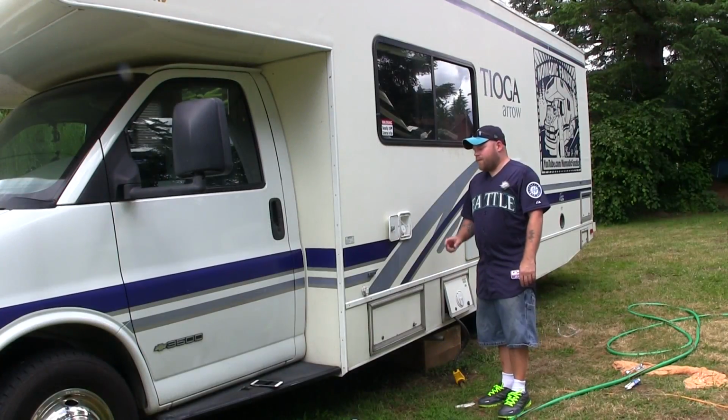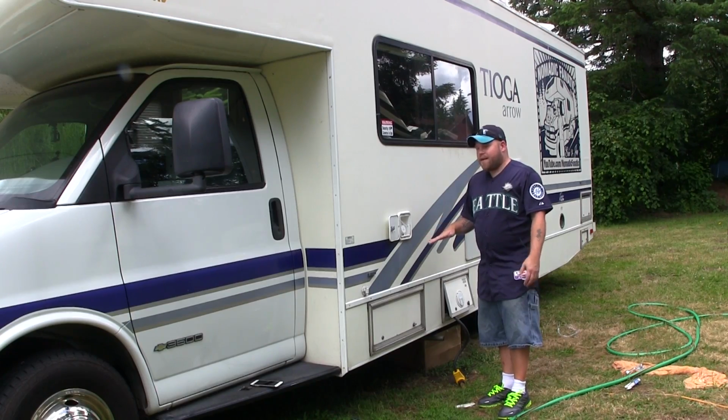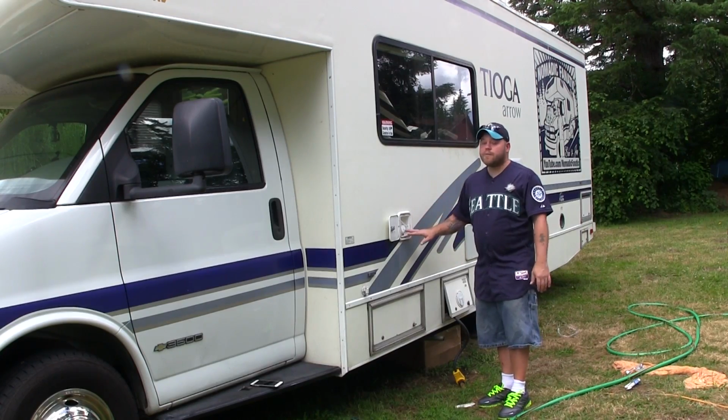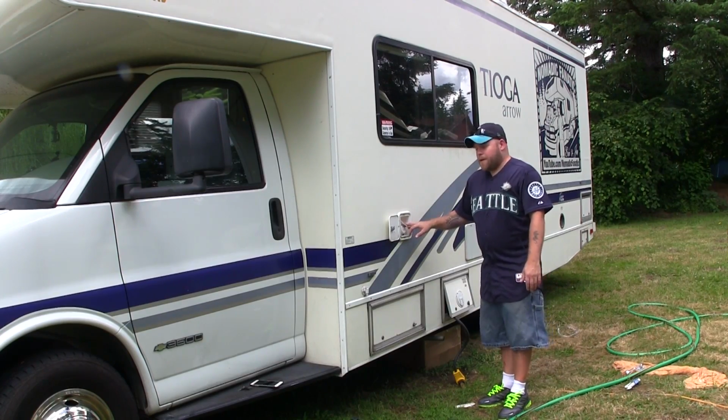Okay, we're back outside. One thing I kind of forgot to mention with letting the water go through the lines in there: my personal opinion is I want to get the water back down to half full. Run your water pump enough so that you're about half full. If needed, you could even add a little bit more bleach to this since you've diluted it a little bit. I like to add maybe one more quarter cup at this point.